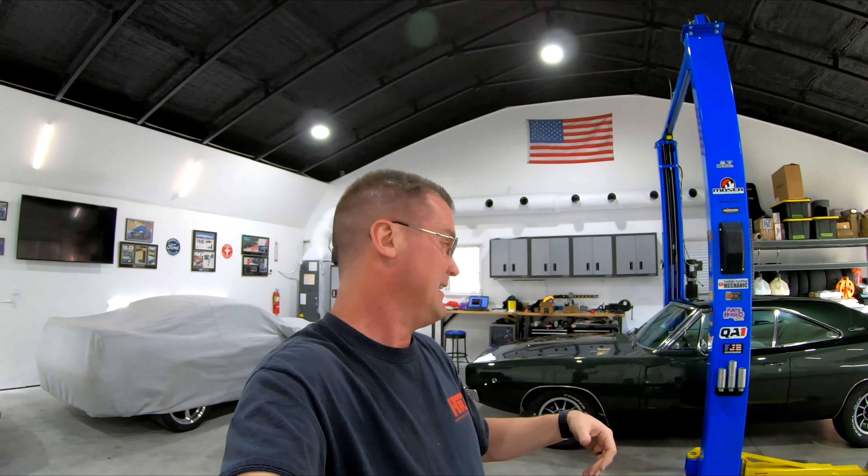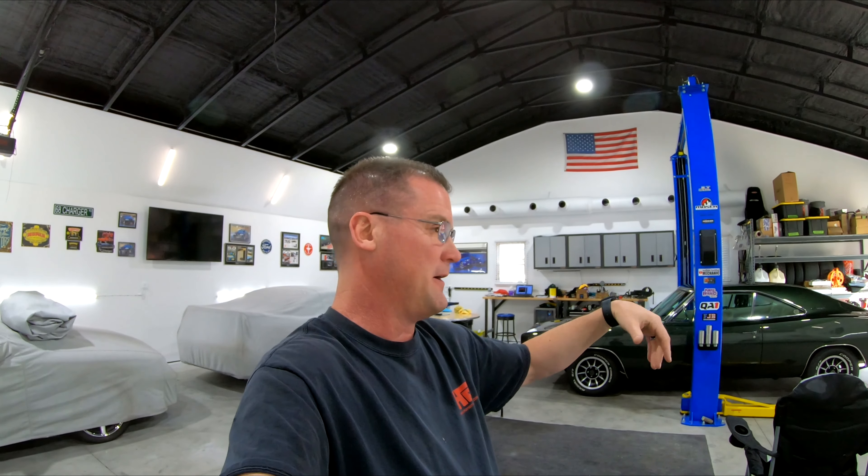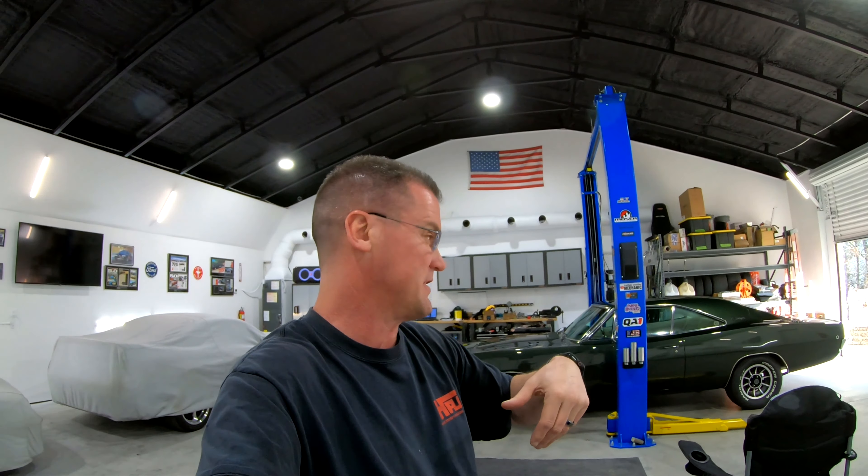None of those 383 big blocks could get 20-plus miles to the gallon, run on E85, and still be as efficient. I really like my Gen 3 Hemi and the 5-speed automatic. With the 5-speed automatic and all that overdrive, running 373s is nothing — it's actually going to be really comfortable with the tall 275-60 tires I've got on the back. So when we get to work, I'm going to raise it up in the air, show you how to take the rear end apart, pull the axles out, pull the rear end center section out, and we'll go from there. Stay tuned.